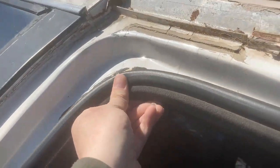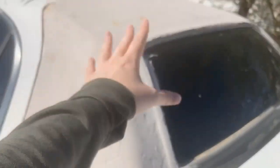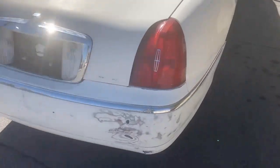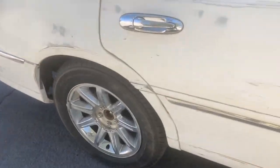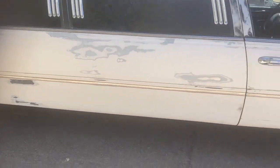That trim piece is broken. None of the electronics back here work, and the lights are ripped out. The lights not working might be because the second battery is missing. There's a lot of stripped hardware. Really bad bondo up here, but underneath it seems solid. Tail lights are a little cracked, not bad. There's a hole here, ugly wheels, more cosmetic defects. The sunroof looks okay — it's a little wonky but it works. More holes — that's really bad.